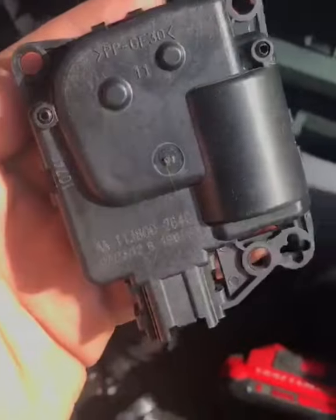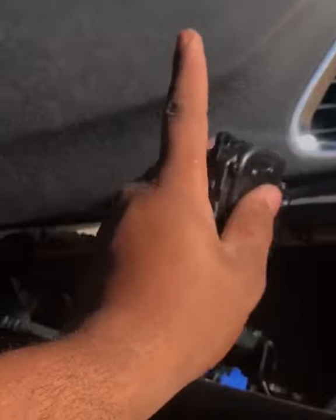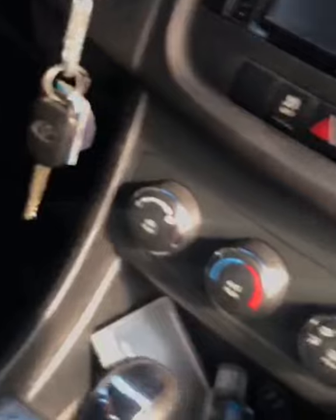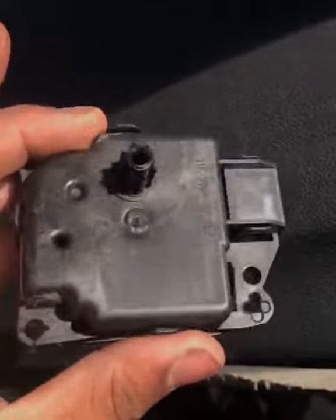As for the actuator itself, all it had was one screw here, one above it, and it sits in this slot with one cable coming from the bottom. As for going back in, we went ahead and pulled this one out and we're going to take it to the parts store to match it up. Once we match it up, we'll go right back in with it. Again, this is the outermost passenger side actuator. I noticed this one clicking when the car comes on and off, particularly when I go through the modes. The one right here, if I'm not mistaken, is for temperature — the blend door actuator — because when I go through the temperature I can hear it but there was no clicking. This is the one we're going after because of the clicking.